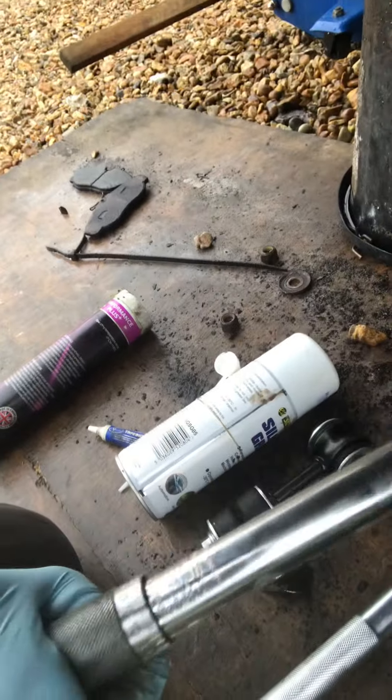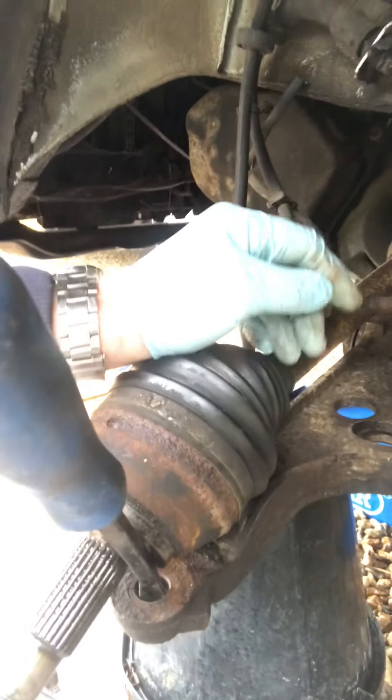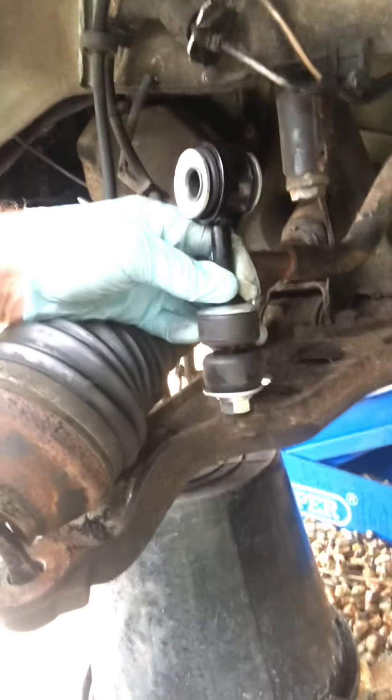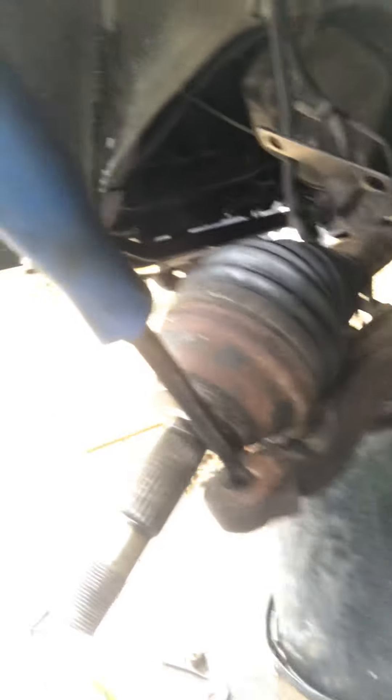From the forums, the top at least is tightened to about 51 Newton-metres. I couldn't find anything about the bottom one, but when you're tightening up you're tightening these two bushes together. The idea is you tighten until they start to swell a bit, to expand a little bit. I probably didn't take it anywhere near 51, but I don't want to damage the bushes. I use silicone grease to spray the bushes, and finish off with a little bit of copper paste just on the threads in case they need to come off again. I've done the other side, and this morning I'm going to do this side — and that's another job done.